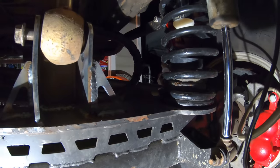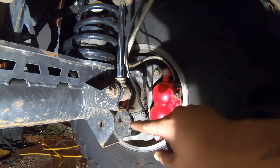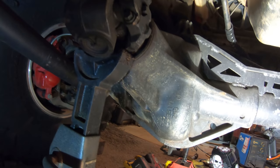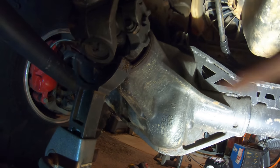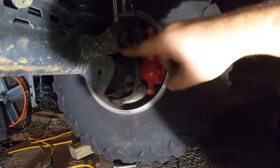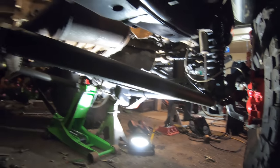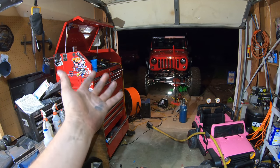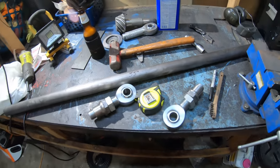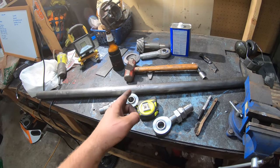There it is — fully welded in. Don't forget to add the gussets on the side. With the axle side and frame side mounted, all we have left is to throw the lower link in, set the pinion angle and caster with a floor jack or jack stand, so we know how long to make the upper link. The passenger-side lower is on, pinion angle is set where I want it. Measuring from eye-to-eye gave me 35 inches. Since it's the upper, we're going with two heim joints for maximum misalignment. Eye-to-eye 35 inches — let's weld it up.